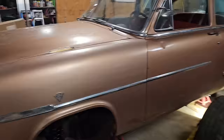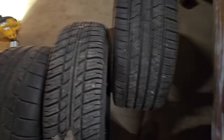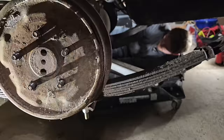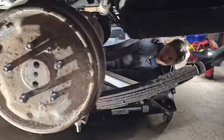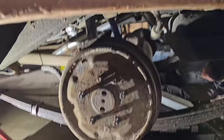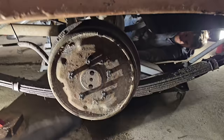All right, guys, so we were having some phenomenal luck and a lot of quick progress. As you'll see, we have three tires over. We got hit in the face. And guys are basically saying that to get rims and tires on these after you lower it to 3.5 inches, 2 inches, 2.5 inches is an issue, but since we're at 3.5, you have to basically uninstall lowering blocks and then reinstall them with a tire on the axle.